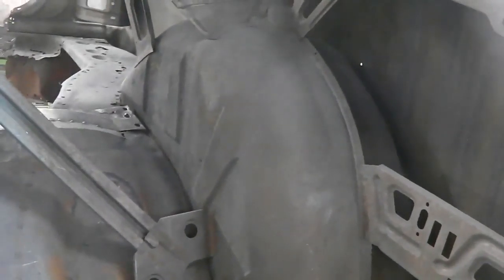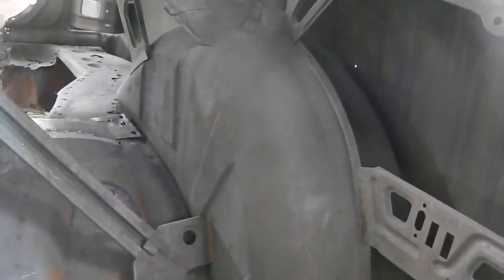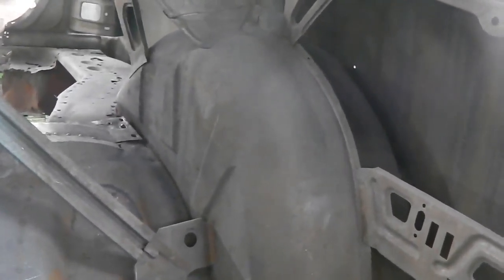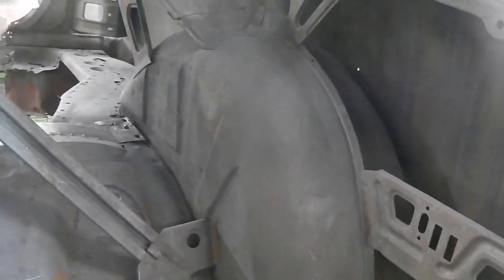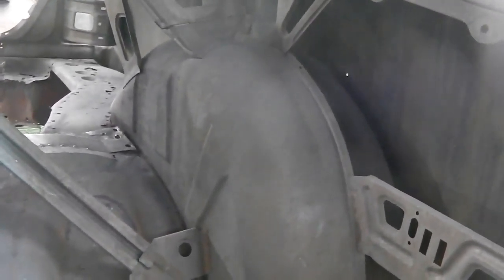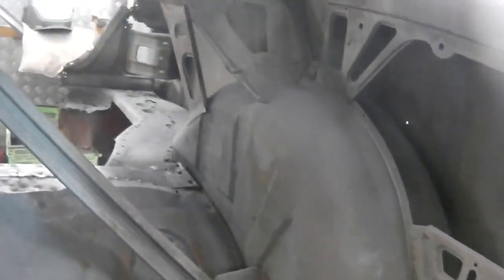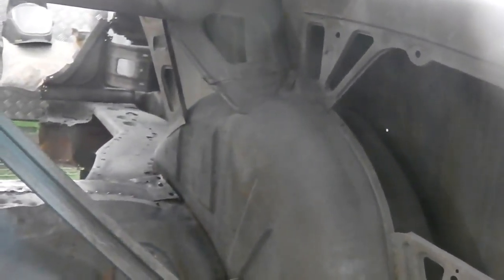What I'm going to try and do is make a pattern and get a really nice pattern piece of metal shaped professionally for that. Or I might find a scrap wheel tub that I can salvage it from. I don't want to take that tub out. It seems such a shame because it's only got damage down by where it meets the sill. Even its rear end, the last tail section of the tub, is salvageable. It's still there.